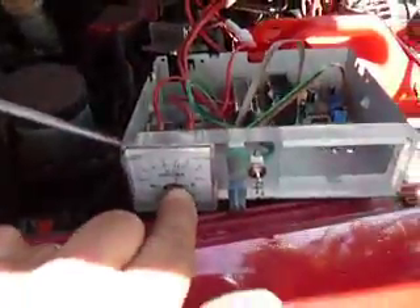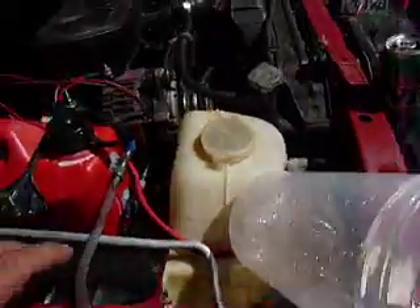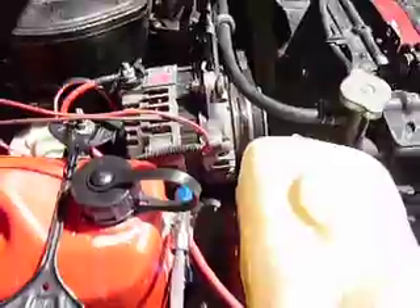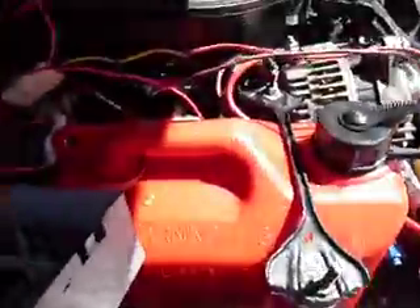The other natural thing about this is the motor demand is less — just a high idle. Even though the field current is still just over three amps, we can see the production is way down. The alternator works a lot better at higher RPM, so 2000 really is just kicking off. It'll be great roaring along doing about 4000 RPM.